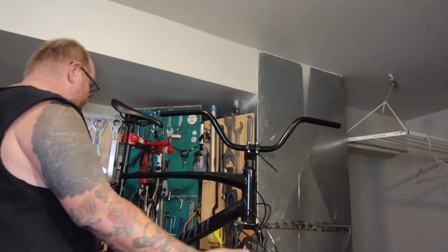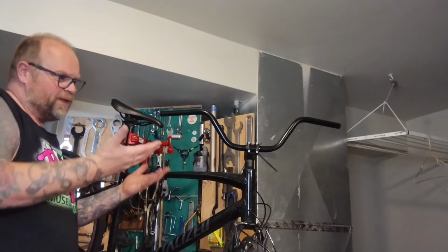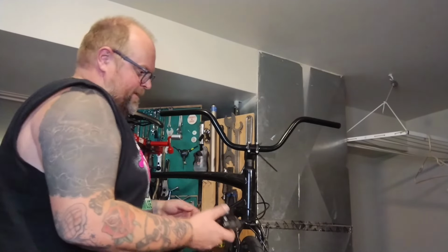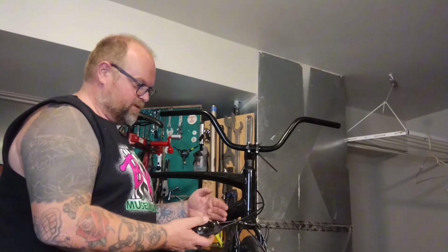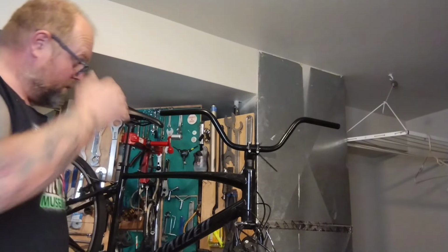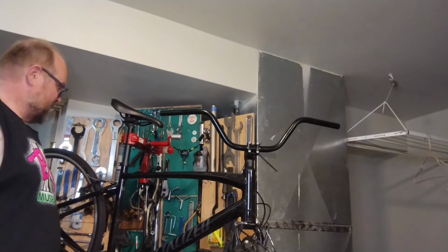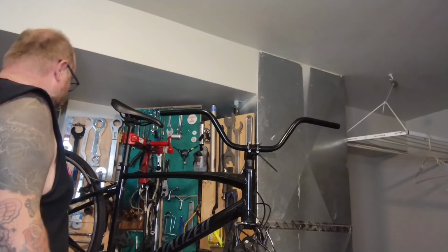So really, I'm just going to replace everything. I mean, there are some double-sided ferrules guys use who like to replace their cockpits all the time. So I could use all of this existing housing, add a double-sided ferrule, and just add a few inches of housing on the end, but it's more work than it is just to replace it all. So replace it all we shall.